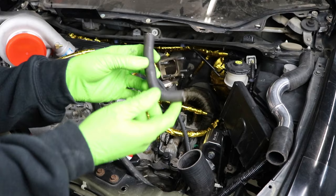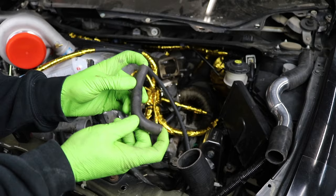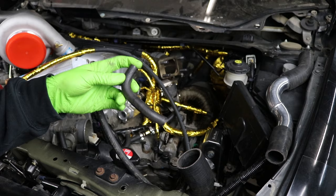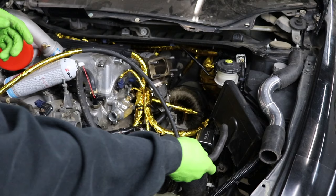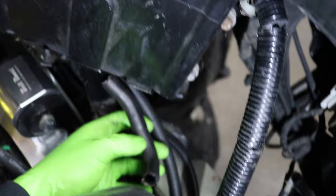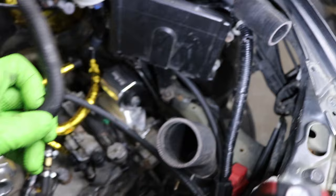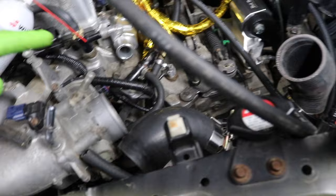I cut the hose out and I want to show you guys something before you put this in because this does have to get installed a certain way. You need to take your mouth and literally blow into this hose — blow that way, no air comes out; blow this way, you can hear air coming out of the hose. So the air flows one way and won't flow back. What I'm going to do is install this right in behind this ECU cover down here. It is going to be tucked up underneath here, so that 90-degree fitting is going to come out just like that — nice and clean and hidden. Then we're going to have a barbed fitting here that connects it to this hose right by our heat tape, and then we're going to extend out this hose right to our intake manifold.